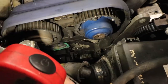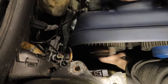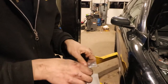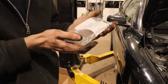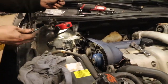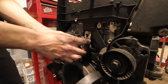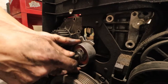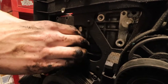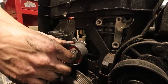This kit from FCP Euro came with new water pump bolts — I'll look up the torque spec, but if they gave them to me I'm going to use them. They already came with Loctite or thread sealer on them. For the timing belt tensioner, when you put it in, it sits in between these two little grooves, then tighten the bolt down. Make sure it's not upside down. If you have an older engine it mounts a little differently, so check that first.